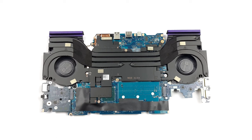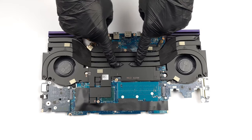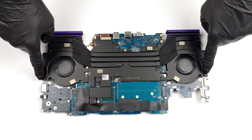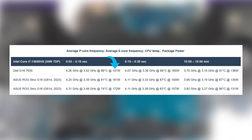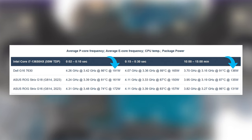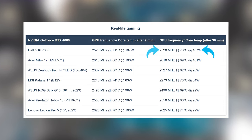The cooling setup of the G16 comes with four heat pipes, which are thick and provide enough thermal capacity. With the additional heatsinks and fans, the laptop is able to exceed expectations, pushing its Core i7 CPU to 191W in the first few seconds of our stress test, lowering it to 136W for prolonged strenuous work. The story with the RTX 4060 is similar — the laptop is able to push it to very high power limits; however, the clock speeds are lower than other laptops with the same GPU.